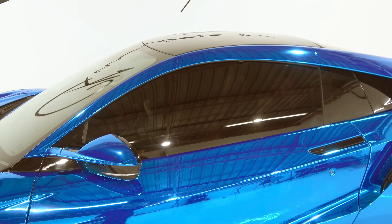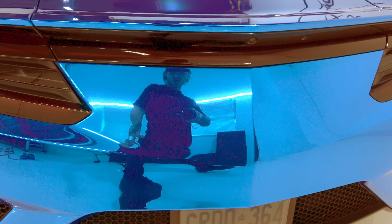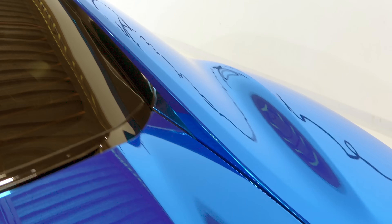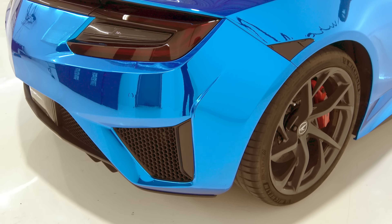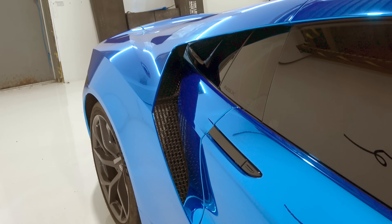There are lots of inlays and seams and things like that — the videos for this car will be on the website. Getting all the way down deep inside — the rear bumper was terrible. That's where I snapped the material, getting all the way behind there. Getting the film around these quarter panels was really hard to do. This lower rocker panel has a high contour in it, which makes it extremely hard as well. This car does have PPF underneath it — you can actually see the line right there. Not even halfway through the rear quarter panel, and about a third of the way through the door. The full front fenders are PPFed, same with the front bumper and the mirrors.